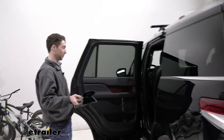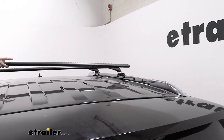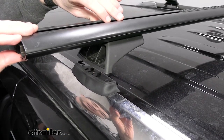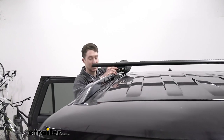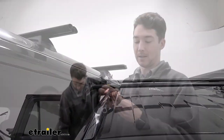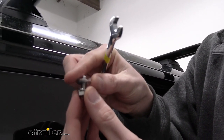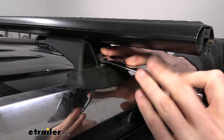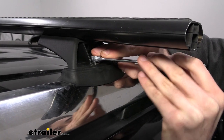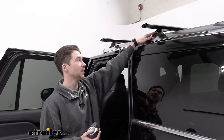Now we'll get our crossbar set up. It can be helpful to have an extra pair of hands to guide the other side across. Place the feet loosely in the bracket so you can slide the next one to fit in as well — that's why we didn't tighten all the way, so we can still adjust the crossbar spread. For the hex bolts where the feet meet the brackets, start with a spring washer and then place one of the larger washers on. A ratcheting wrench is helpful given how little clearance there is, but a normal wrench works too.